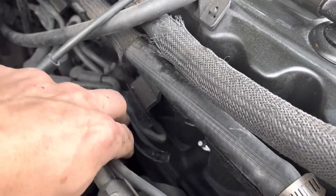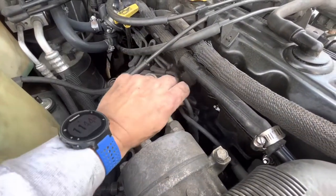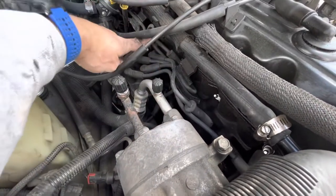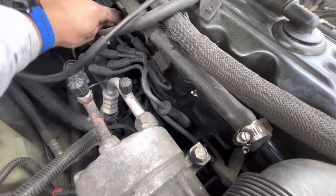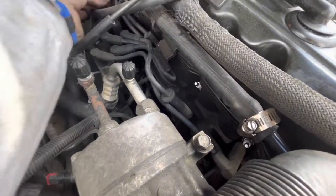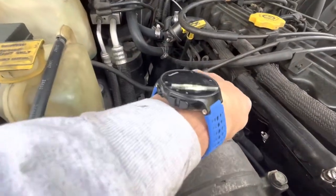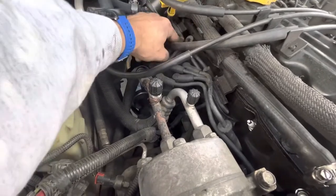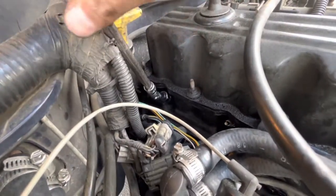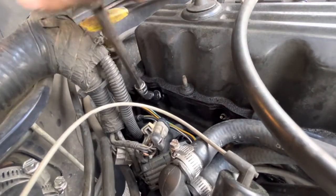The first two are relatively short and they go through the bottom and the top. So this is four — this was one and this was two — so this is four and it loops back around, whereas three does the complementary thing on the other side. Three is the middle one right here, going in the middle back here and looping around. So we just need to remember that four does the mirror image looping that three does. For this last one, because of the wiring loom, I'm using an articulated joint to get it out, but it's coming just fine.